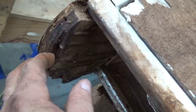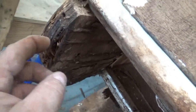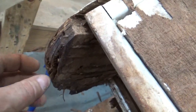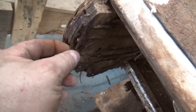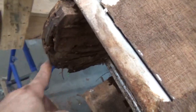Back here at our chateau. One of the other problems that we noticed here is this is plywood, and that's the way they usually cut these radius pieces. You can't put a screw into a grain like that — it has to be going through the plywood this way, not this way. It's kind of like trying to put a screw through all the little fibers of a broomstick — it's not going to work, and they don't usually hold. That's one of the problems. We're going to put solid stock in there.